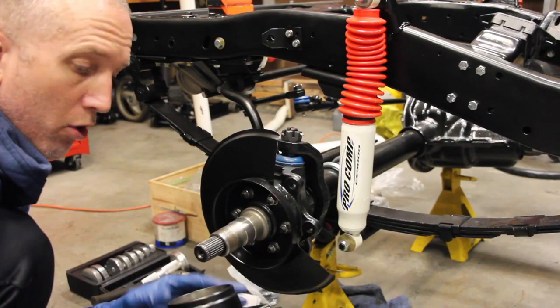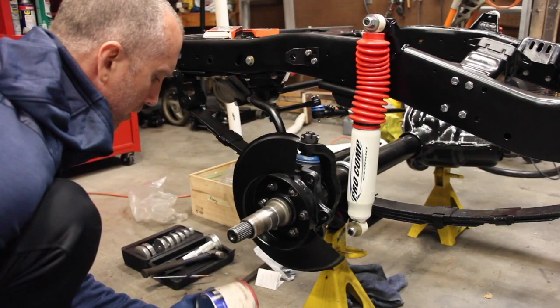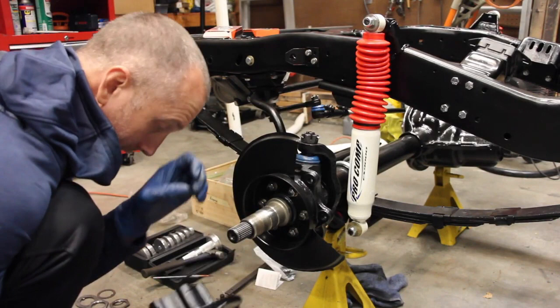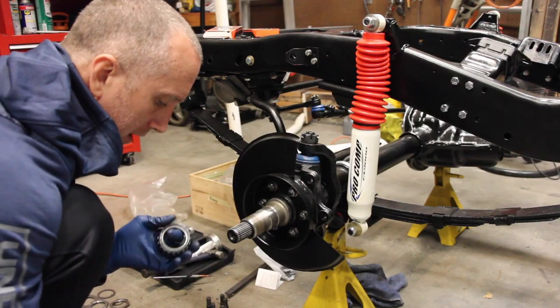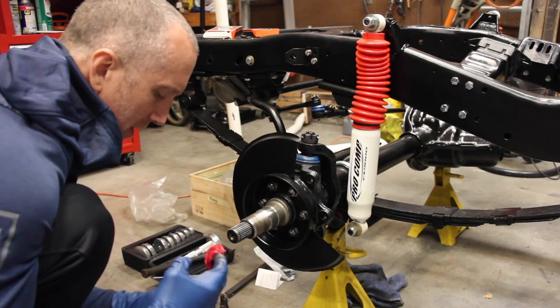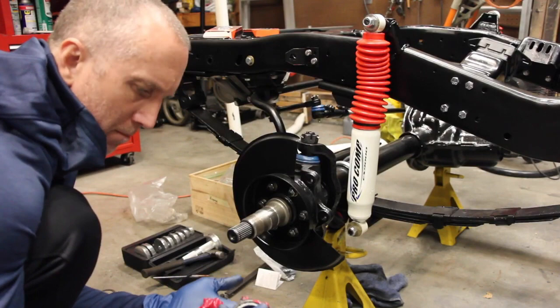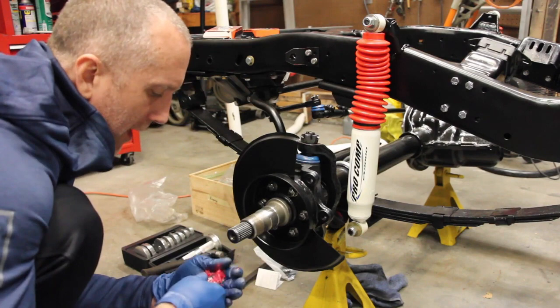Let's get this thing back together — you'll definitely want some gloves and good bearing grease. I've been using Mobil One red bearing grease, which is pretty good stuff. You want to pack the whole inside of the wheel hub heavily with bearing grease, but start by hand-packing the actual bearings themselves. The technique I've seen well-renowned mechanics use is to take a swab of grease, take the bearing, and just press and roll — press and roll — getting it into the sides. Get this thing as lubed up as possible before assembling the wheel hub.